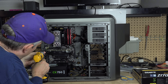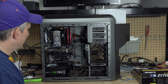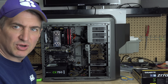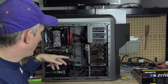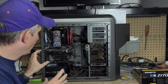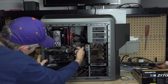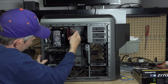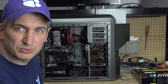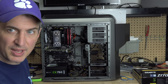It's probably not the Wi-Fi card preventing the system from booting, but it wouldn't hurt to do it while you're in there. Take your time, be careful, and pay attention to how things look before you take them out. If you're not sure, take your smartphone out and take pictures of the inside so you know what it looked like before. When you get the graphics card back in, the little locking mechanism works like the ones on the memory slots — it should flip back down again. Hopefully that will fix your boot looping. Again, the most likely scenario would be reseating the RAM.